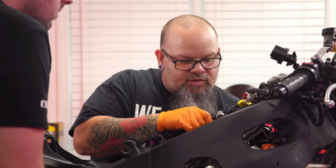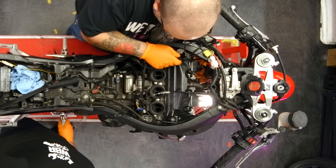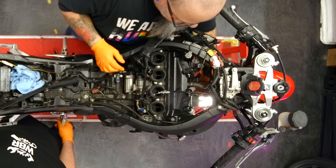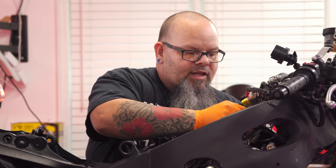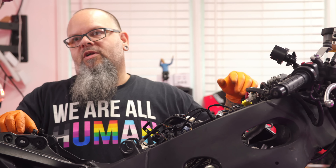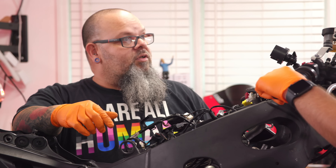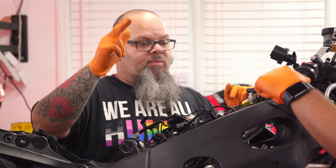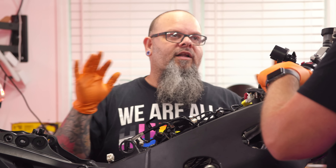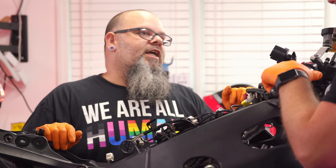This is the cam position sensor - undo that as well. It's in a bad spot: it's bolted in place, it can't turn, and the release for the spark plug boot is underneath it. Things like that on Honda drive me insane - all this room you'd have to make to remove the valve cover to inspect the valves, or even just to replace spark plugs. You have to remove the airbox, throttle body, throttle cables, secondary air system, and all this wiring harness just to get to the spark plugs. That's one of the reasons I don't particularly like Honda - fantastic riding machine, but when it's time for maintenance it's a battle.